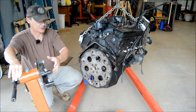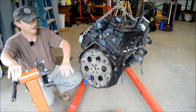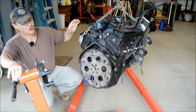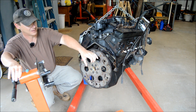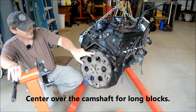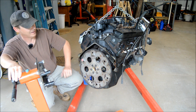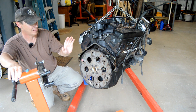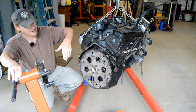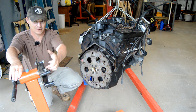The engine stand manufacturers will tell you that you should center up with the crankshaft and try to center your engine stand with that. That's great on a short block that doesn't have cylinder heads on it. But when you put cylinder heads on there, that adds a whole bunch of weight to the top end. So I find that somewhere in this area right here, you try to kind of get in between — right around here is probably the best spot. That'll help you if you have to turn the engine over with the cylinder heads on. You want it to be relatively balanced, because it'll get top heavy and it can get away from you and hurt you. You want the weight of this engine to be balanced over the center point.